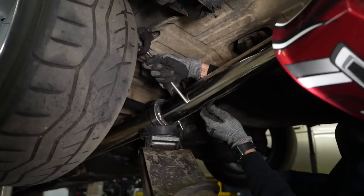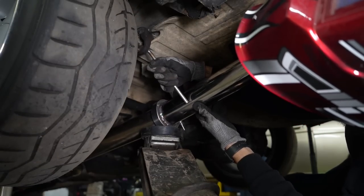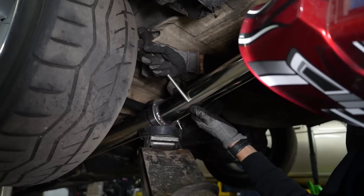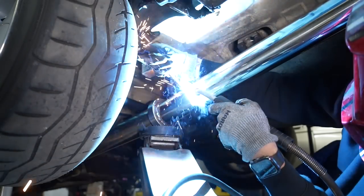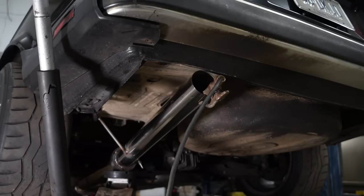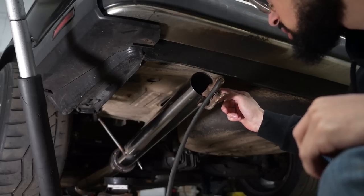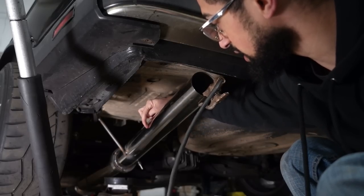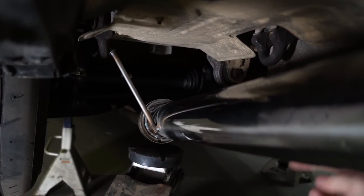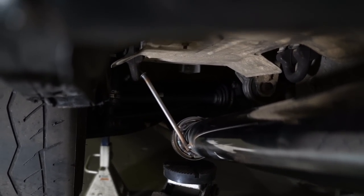I don't know how much preload is too much, 'cause it might be really hard to take the hanger off once both of them are in and super tight against each other. I'm gonna put it as tight as I can by hand, with the pipe touching here and on my subframe, so hopefully when I let go of the jack it'll lower down a tiny little bit and be exactly where I need it to be. Yo Ryan, I need your opinion real quick on the lining up of this exhaust - is this good enough left and right? There's a lot of movement but I think right there is where it should be compared to the tail lights. I'm sending it. Let's see how much the exhaust moves taking that jack off - that's pretty good, it moved down just a tiny little bit. Now I want this second hanger to come to this side so it can add some tension and pull the exhaust this way, hopefully solidifying it.